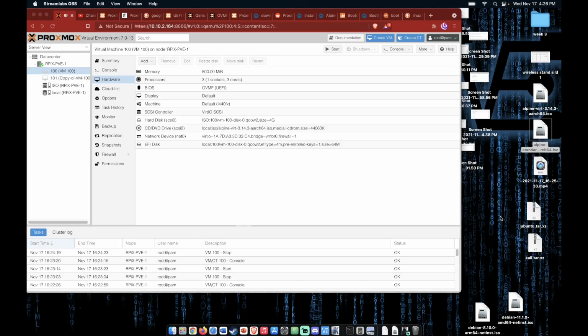So, we have gotten a working VM to run on Proxmox, but I can only successfully get them to boot off the CD. So the first thing I want to inform you about is that we will need to configure all systems with a SCSI setup, because both the SATA and IDE drivers from Proxmox appear not to be working. Also, I have found performance benefits with serial display drivers, but the default display drivers do work. We're also going to have to configure BIOS to UEFI and add an EFI disk.